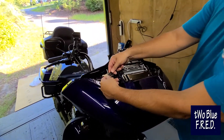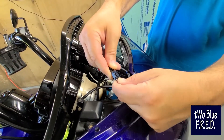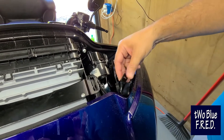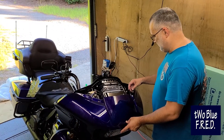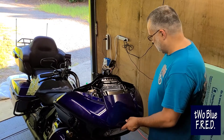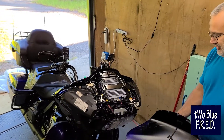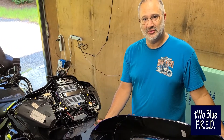You have some connectors — they're just quick-connect. Squeeze them and they come apart really super easy. You've got one on each side. Disconnect those and that'll free the fairing. After you've disconnected the turn signals and got all ten bolts out, the fairing cover will just slide off, exposing the electronics. Give yourself a workspace and set the fairing aside in a safe place so you don't hurt it.